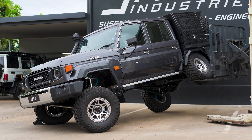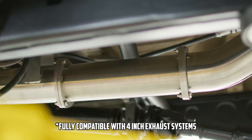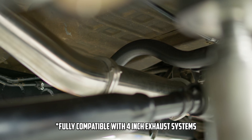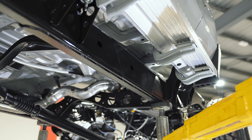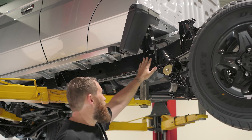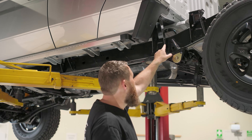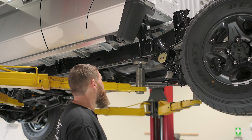It incorporates our fully welded, purposely designed cross member and we use angled cuts for joining the rails back together. The factory cab mount obviously used to live here before — it was 300 mil longer — gets moved back, and we've copied the design, trying to keep it looking as OE as possible in the manufacture of our replacement cab mount.